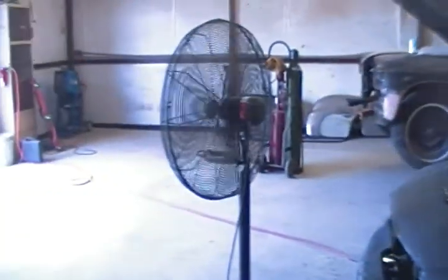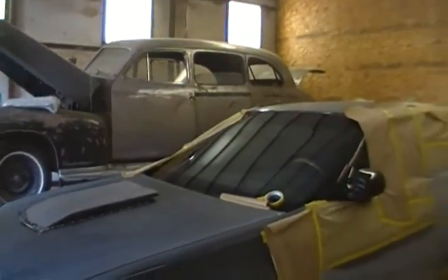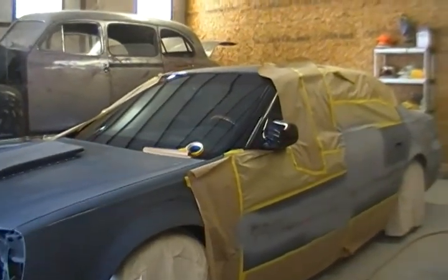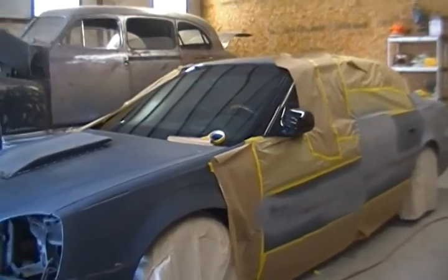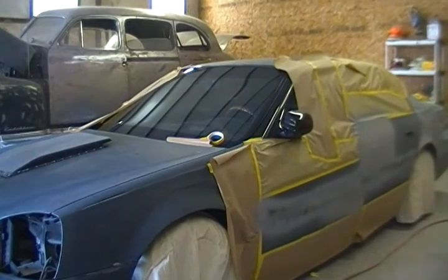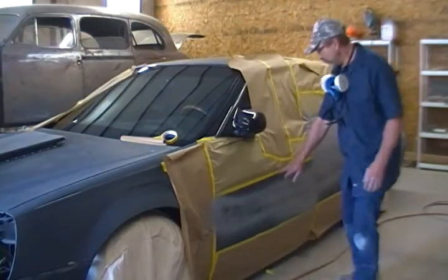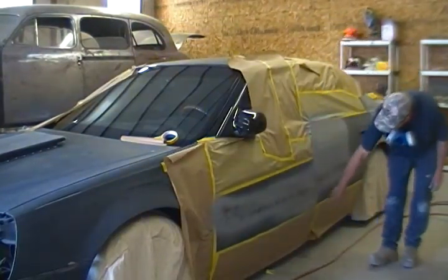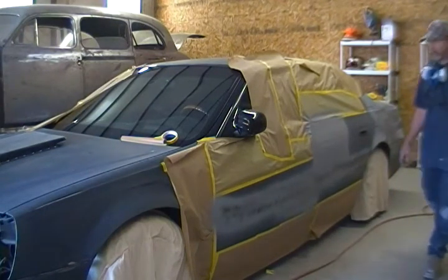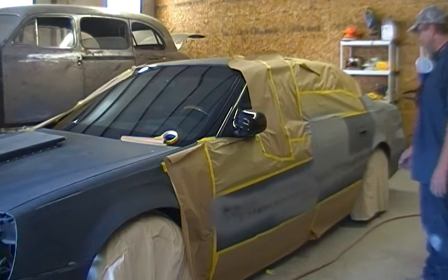Alright, so you watched how we were able to take the atmosphere and suck it out of here so that epoxy primer wouldn't make it to the windshield. It didn't. I could see that. And we've only masked off enough areas to limit the areas that we wanted to spray primer. So even though we might have a line here that goes away, we're not spraying directly up the inside tape edge. That's just to block some areas off, just to make it quick and easy and try to get past that point. So at this point, we're going to let that cure overnight.